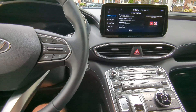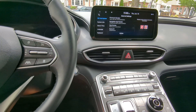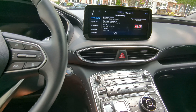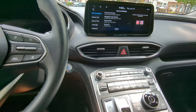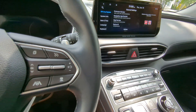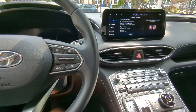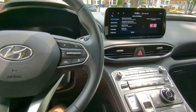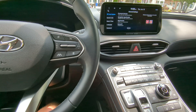And that's it — you just sit back and let it do its thing. People have said it takes 25 to 35 minutes. On this car, because I've never updated it, it took over an hour. I didn't have to leave the car running — it actually tells you right off the bat you don't have to have the car on; it'll just do it silently in the background. It does give you progress, reboots a whole bunch of times, and flashes the dashboard a few times. It also warns you that you can still drive the car, but certain features will be disabled, mainly the backup camera and things of that nature.